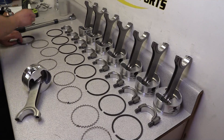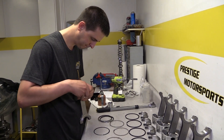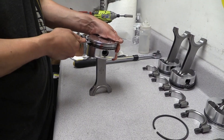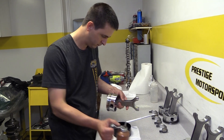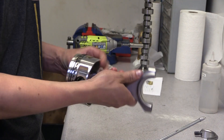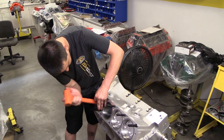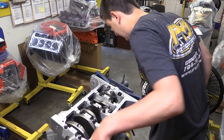The goal of this engine isn't ultra high horsepower, since it will already be going into a super lightweight car. It'll be naturally aspirated, so the ring gaps are fairly standard — 22 thousandths of an inch for the top rings and 24 thousandths for the seconds. The idea for the slightly larger gap on the second ring is to allow any combustion pressure that gets past the top ring to move on into the crankcase. Too much pressure trapped between the rings can cause ring flutter, so even though you don't want extra pressure anywhere, it's much better for it to be in the crankcase where it can escape out the PCV valve than trapped between the piston rings. Once everything is together, McCleary drops the pistons and rods into the block. After double-checking stretch, each of the rod bolts are tightened to 75 foot-pounds with moly lube on the threads.